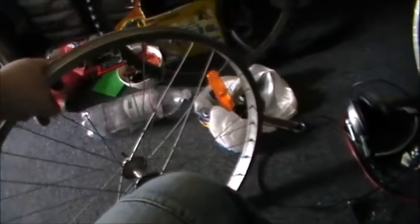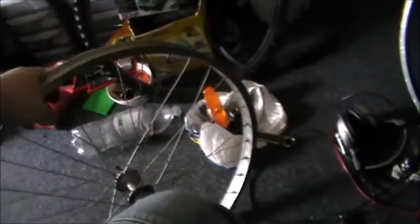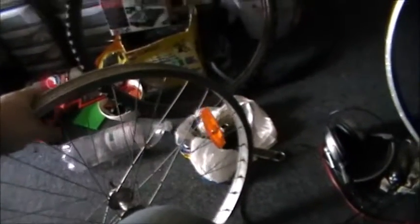I've actually noticed I've done pretty well — there's only 4 original spokes left in this wheel. It's these two, and pretty much two opposite here as well. They're the only 4 I haven't replaced; the rest have all been replaced. So that is definitely a lot sturdier and more rigid than it was. I'm going to give that a whirl, back in the bike.